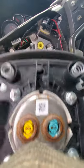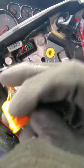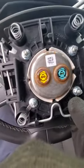You'll have two wire clips here. Just pop this little orange clip out of the center — you don't have to pull it all the way out, just pop it out enough to release the clip — and then you can pull your airbag out of your steering wheel.